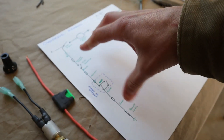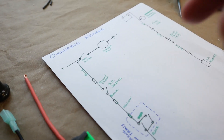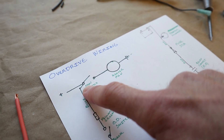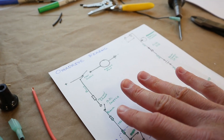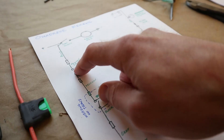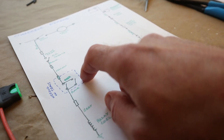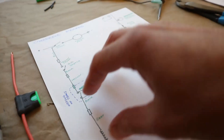I drew up what we're gonna be doing for the overdrive wiring. To get power for the switch, you need something that is switched with the ignition key on and off. So we're pulling that off of this fan switch, which is tied into the ignition switch, so that when the car is off none of this will have power to it. Then we run a wire down here — comes to the overdrive switch that's up in the steering column. From there we come down to the overdrive itself, where there are two limit switches that prevent you from putting the car into overdrive unless you're in the higher gears.